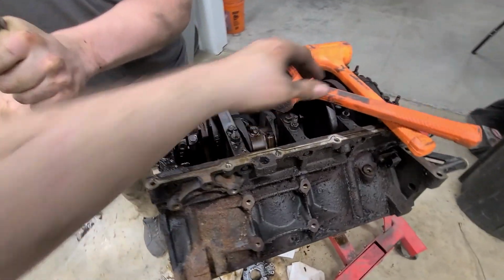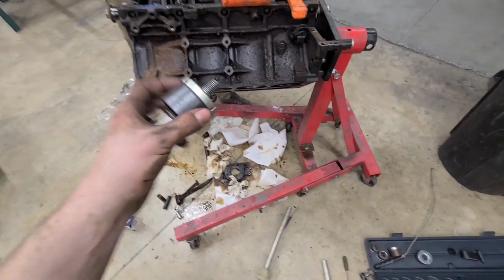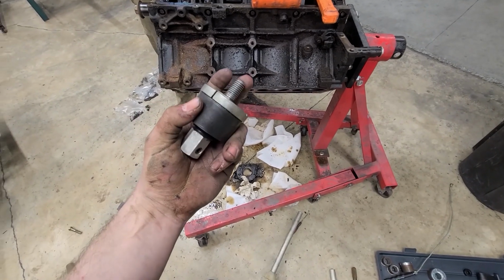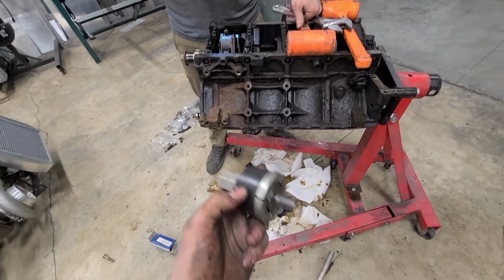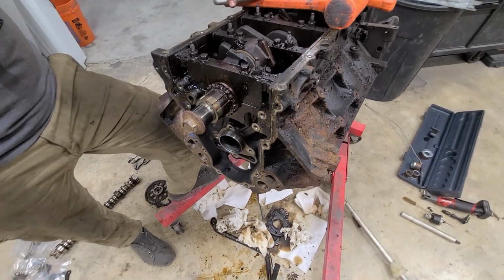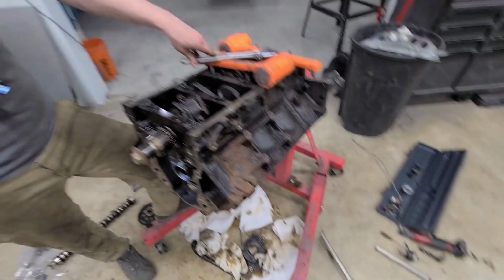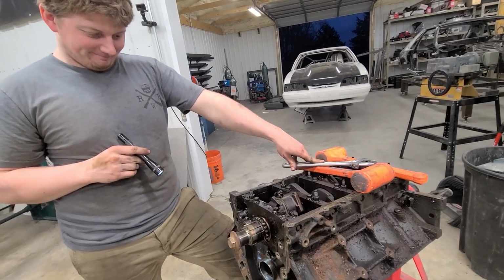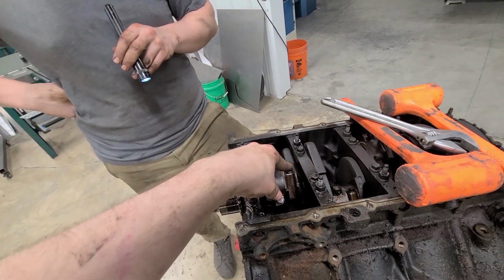Well, we're kind of at a standing point here. You have to drop this down in the cam bore, then stick the rod through and hook up to these threads on the back, and then you run the cam bearing that way. But you can't when you're cranking. So we tried to tap it in from the front, but it didn't want to go in that way. I was hoping I could hold it straight enough, but it turns out you have to have that cone on the end. It's a very crucial piece of equipment. So now the option is to take one of these rods out.